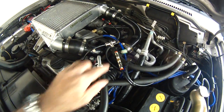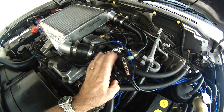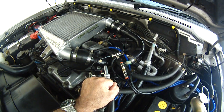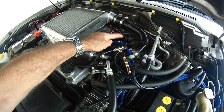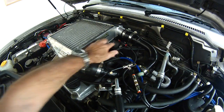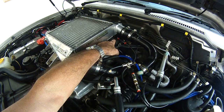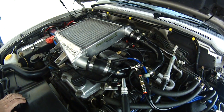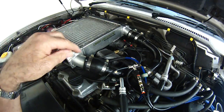Here we have a 40-micron filter that can be removed and cleaned. The filter sits between the pump and the injection points. Then we go into a T-piece. From the T-piece we go off to an injection point in the throttle body. This is a non-return valve, and that is the nozzle and nozzle holder — a 0.75 gallon per hour nozzle that keeps a steady supply of water through there and keeps that area nice and clean.